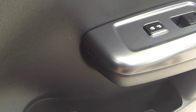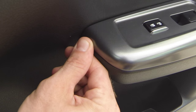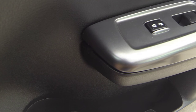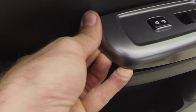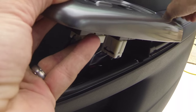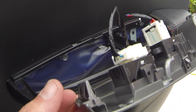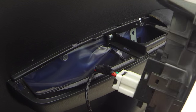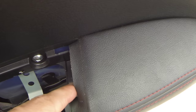After that you're gonna see a little area right here where you can insert a screwdriver and push up on that. That's gonna allow this piece to pop out — use a little bit of force, not too much so as not to break it. This piece is going to come out and your wiring for your doors is connected to it, so be careful. There's a tab on the front and a tab on the back that go into the corresponding areas.